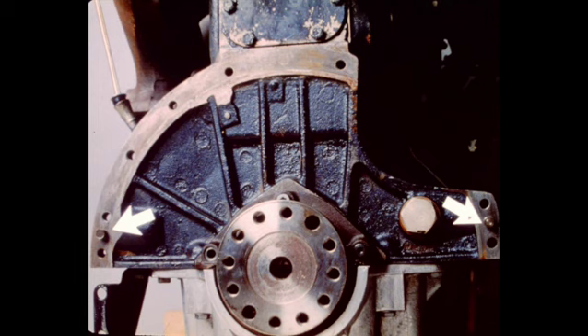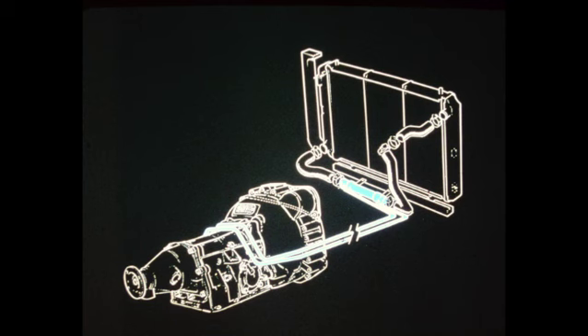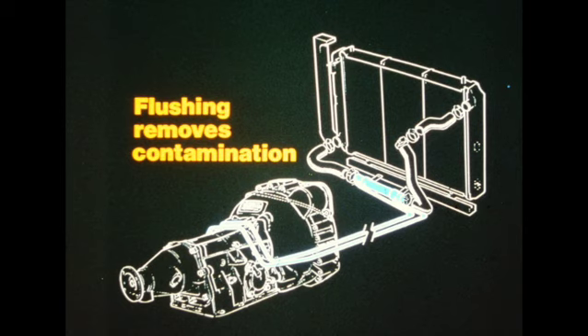Certain Series 3 vehicles were not originally fitted with locating dowels; however, new dowels must be fitted before the transmission is installed. When fitting a new drive plate, two locating dowels available through the parts department must be used. These are installed through the two slightly larger holes. Number two: the two locating dowels between the engine block and the torque converter housing must be fitted when the transmission is installed. These can easily be misplaced or dropped when the transmission is removed. Number three: the transmission oil cooler and oil lines must be flushed thoroughly with ATF before operating an overhauled or exchanged transmission. This will remove all traces of contamination which remain in the system as a result of previous failure. If this is not carefully performed, failure of the new unit could result.